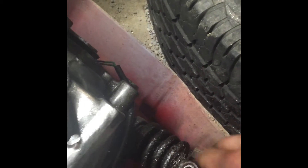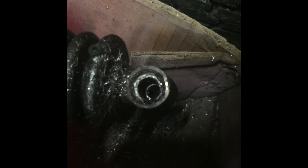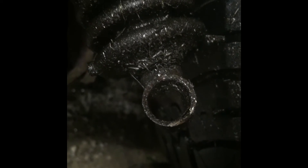On the Mazda, things don't always go as planned — especially if you live in the north. This is the transmission all polished up, and what's been giving me all the trouble is the shift selector right here. I've had to drill it out. I know I'm slightly off-center on one side, but the other side is centered. I've been stepping up drill bit sizes — I'm at about a half inch and I'm still not through. I'll let you guys know how I fix it.